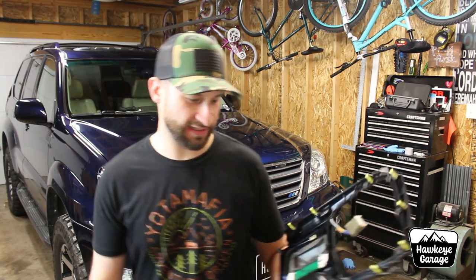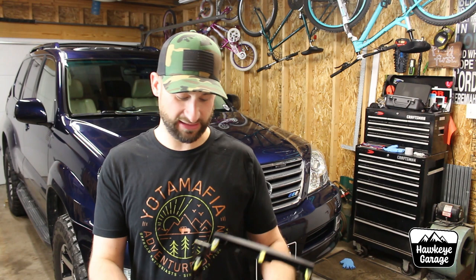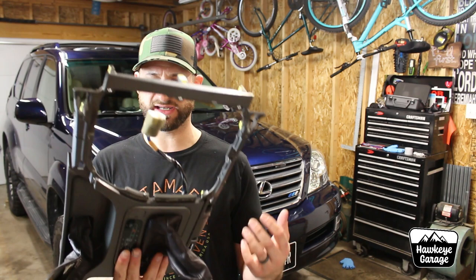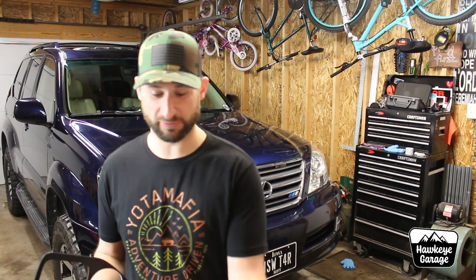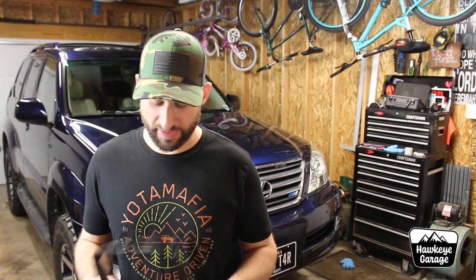This is not a one-size-fits-all final solution plug and play. There are some things that you're going to have to deal with — the air suspension and other suspension switches, you're going to have to do something with those. I've just got mine tucked up underneath in the center console for right now. Eventually I'll be getting away with all of that because the air suspension will be gone. There is a wiring harness that runs underneath this for the indicator lights for the shift bezel and a couple other things. You're going to have to unsnap those from this top plate and kind of shove everything down in there to make room for the cup holders. If you're competent enough to attempt this to begin with, you're competent enough to move the wiring around and it's not going to be a big issue.